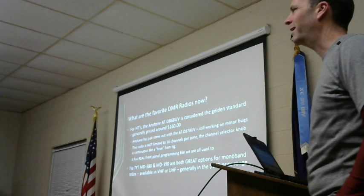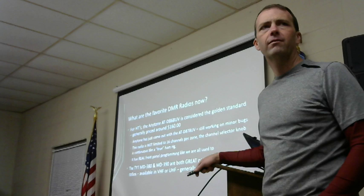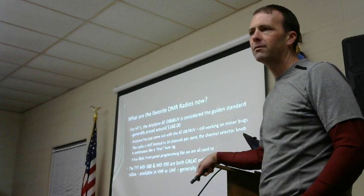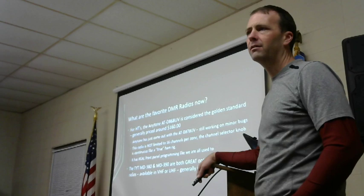Yeah, the issue with virtualization there is if you need to access a serial port for real hardware, then it can throw you timing issues for programming, and then you brick things. Yeah, but then I could throw Windows on an external hard drive, couldn't I? Yeah, if you boot it natively. That's how I did mine. Or like on the Mac, I could just use Boot Camp. Does Boot Camp do COM ports?